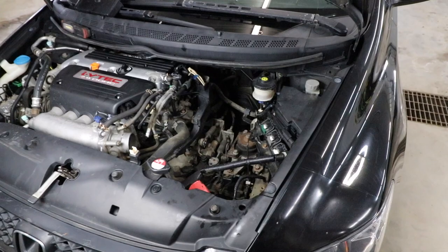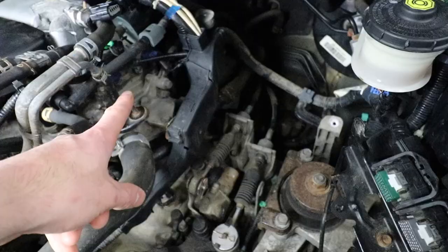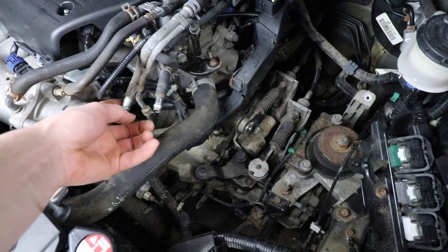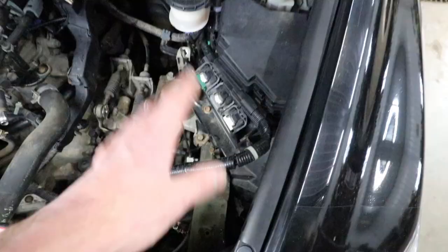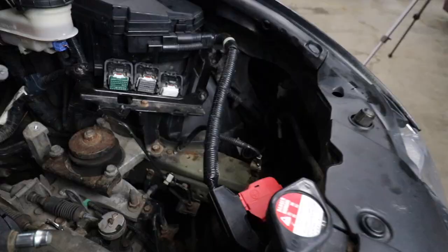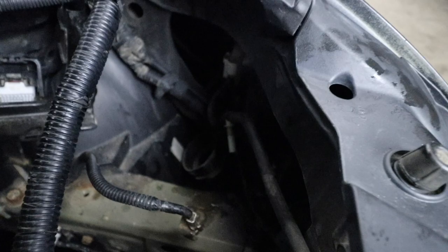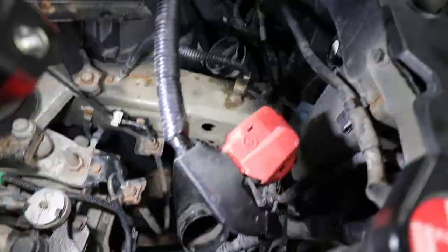We got most of the intake stuff torn out now. There's just one bolt on the bottom that holds the intake on, a stud up top with a nut, another bolt, and then you unplug the MAF sensor, disconnect the two PCV lines, the couplers to the throttle body, and take all the intake pipes out. I also took out the battery tray and the ECU just to give myself some extra space, plus one more intake pipe that goes into the fender.